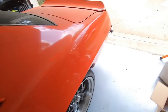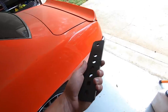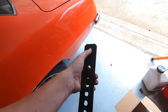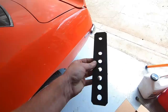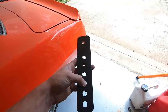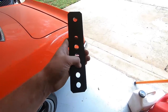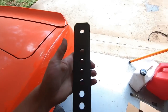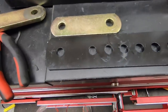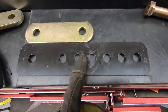It's now the next weekend and I'm back on the Camaro project. My new shackle plates have arrived — I have four of these. I could have made them but they're only about $12–13 on Summit so I just ordered them. It looks like if we use the top hole for the frame bolt, somewhere around the center hole or just below is probably what we'll be shooting for. Once we figure out exactly which hole we're using and everything's finalized, I'll trim off the excess so there's not a big two-inch bar hanging below the back of the car.